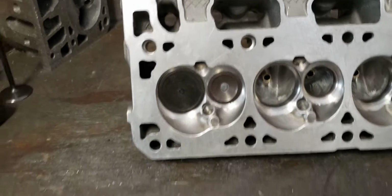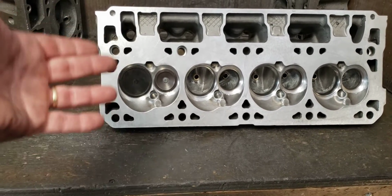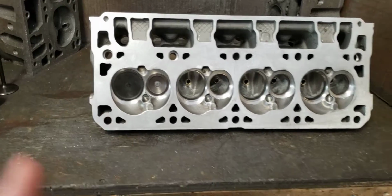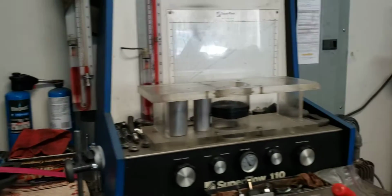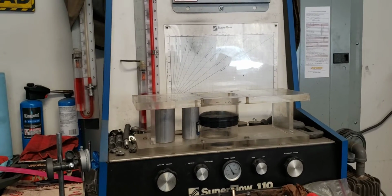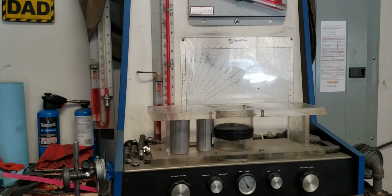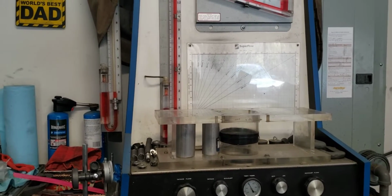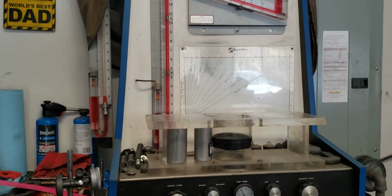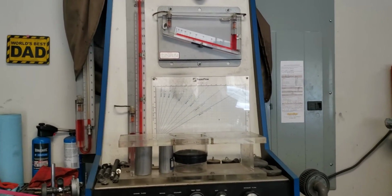So just quick recap. We talked about combustion cycle, how it works, overlap, talked about flow benches, differences between flow benches, depression 28 inches versus 16 to 5 inches. There's also a new standard for testing your short turn, which is like 44 inches. That's good and all. I would use that.